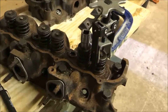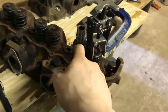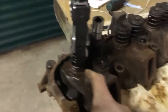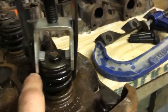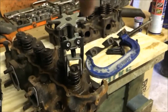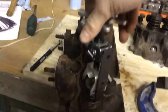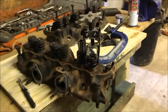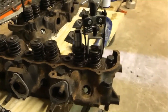I'm back. I had to use a G-clamp and a 14mm socket to break the seal with the valve keeper, because it had actually seized. I've done that just on this one to demonstrate. As you can see, I've used the compression tool and it's popped up again, because previously I was twisting it and nothing was happening. So it should be easier to come off now. I'll have to use two hands for this, but I'll be back in a minute and just show you how I got around the seized keepers problem.